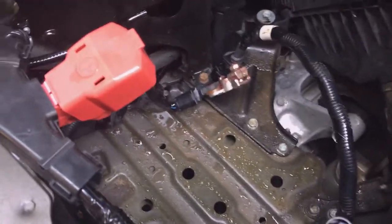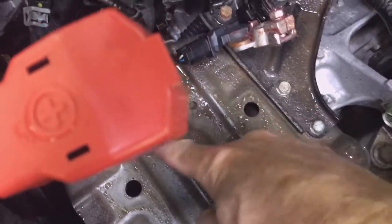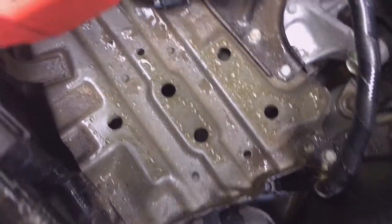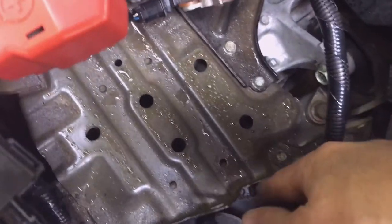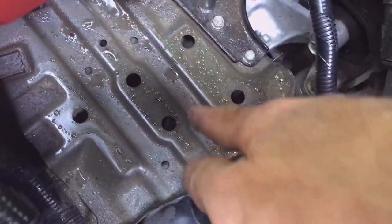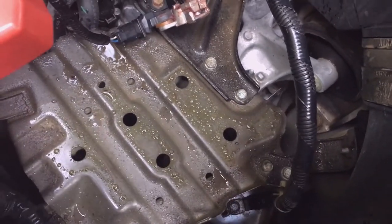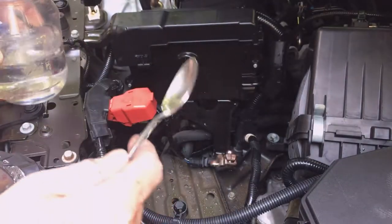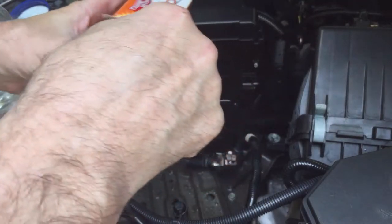Here's why I want to clean the battery tray. See how this battery doesn't vent — the water stays in it, but if it runs out it has to run off onto the metal of the car. See how it sits in the metal frame of the car. I want to clean all of that with baking soda so it'll neutralize any acid that's gotten down on the metal and in the frame. For the solution, I add several teaspoons of baking soda for every cup of water.